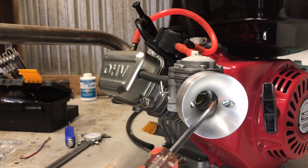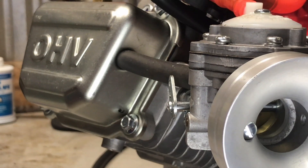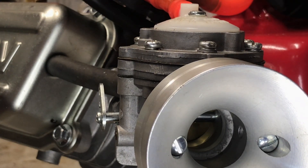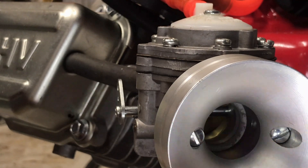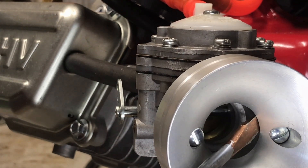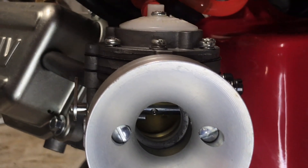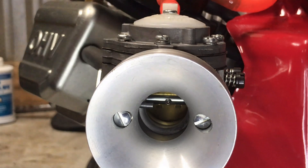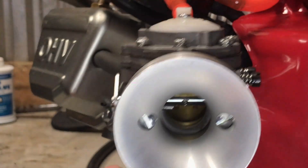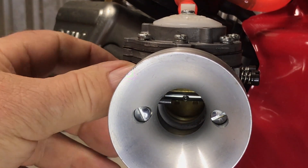You can feel there's an edge there you can catch on, and although the hole is still larger than the venturi on the carburetor, this would work — but it's not an ideal transition for the air. It would slow down a lot as soon as it hits that passage and opens up into a big area. These little carburetors — the intake and air filter adapter is a big add-on that adds a lot to the price, but you really can't beat them. I like the Tillotson pump carburetors — really good stuff. That's all I got for today guys, thanks for hanging out with me, we'll see you next time.